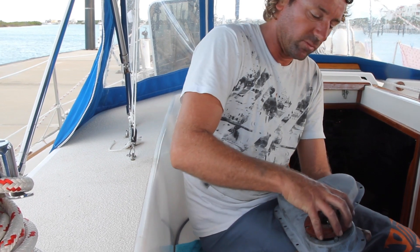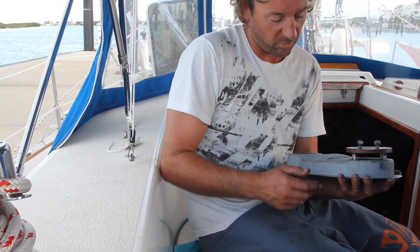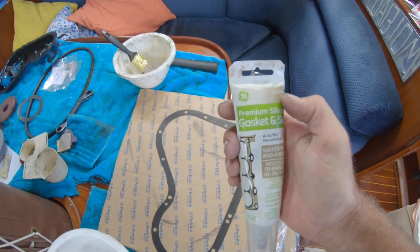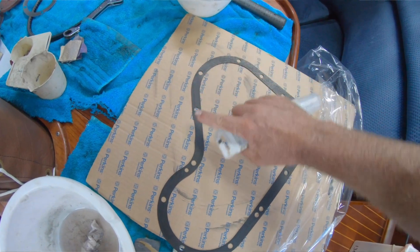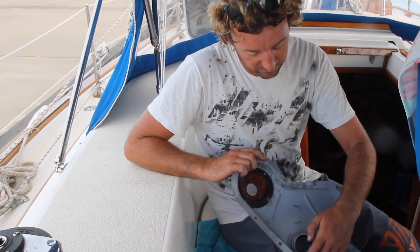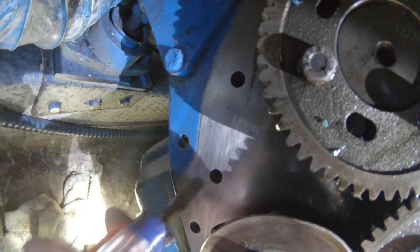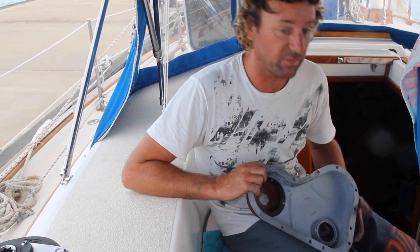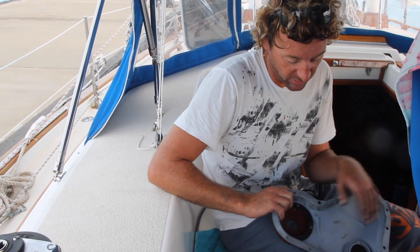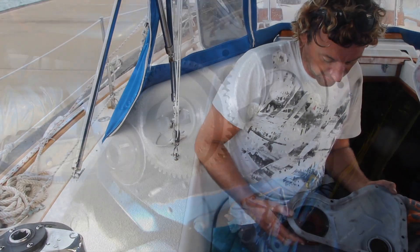We've got to get this right. It's going to take a bit of time to do a few dry runs and make sure everything goes together properly, because once I start this job I'll have gasket sealant going off. I'll need to seal the gaskets, assemble them, and do them all in one hit. For this gasket I want a good seal because the old one was leaking. I'll replace it with silicone seal. I've cleaned up the mating surface on the engine and I'll give it a rub with sandpaper and clean it with acetone — it needs to be spotlessly clean.